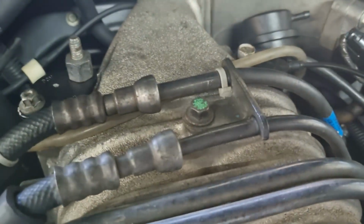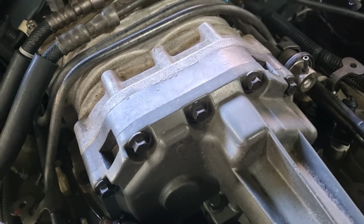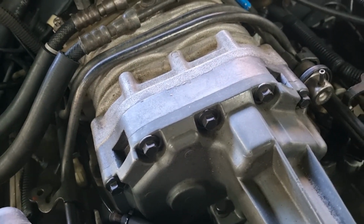But yeah, I'll walk you through that. You got a bolt there for an L67 as well. But yeah, take off those fuel lines, take off those bolts and take off those clips off the injectors. Pull it off. You don't have to pull the injectors out with it, but it might be better to pull the injectors out, because then fuel won't just go everywhere.